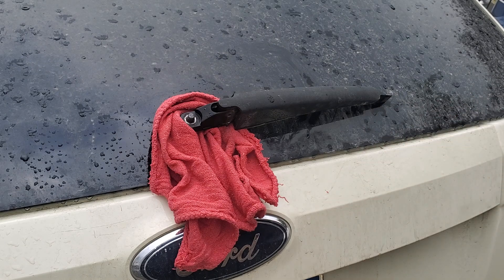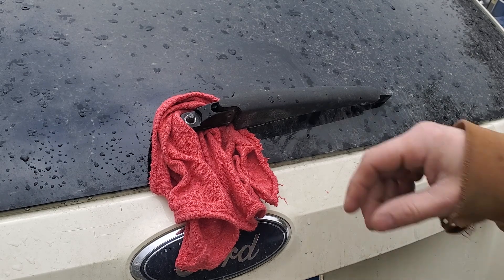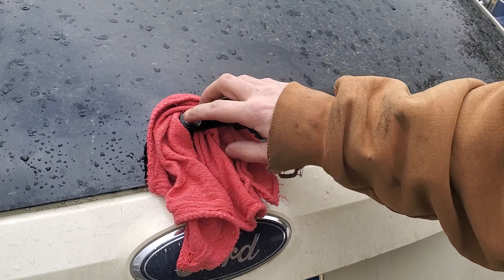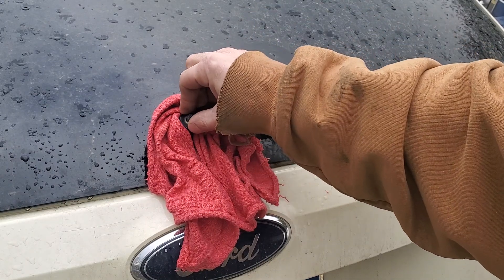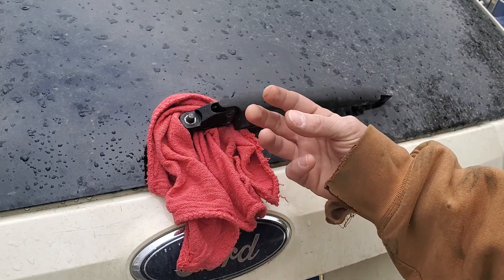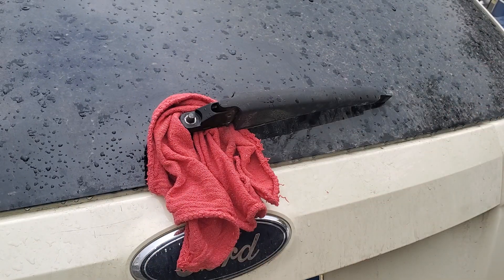The way these work, they have a little cap that covers the shaft and the 13mm nut that holds these on. These things pretty much just slide right onto a shaft. There's a spline on it that kind of grabs it and holds it in place, and that's what moves it whenever you turn on your wiper blades.